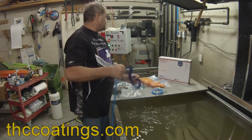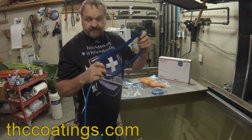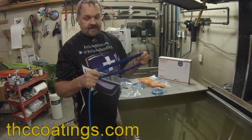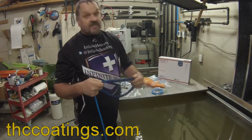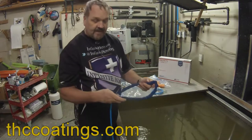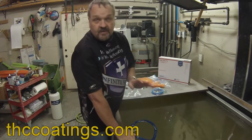This is really important, guys. Activator doesn't like this inner hose — actually, it loves it. So what I've been doing is spraying the outside canvas area of the hose with silicone — your waterproofing stuff, Scotch Guard, whatever — to try to protect the inside layer of it. I've been having some complaints with some guys, and I'm not sure if they're not rinsing them off after they're done, but the activator is actually eating into the hose itself.